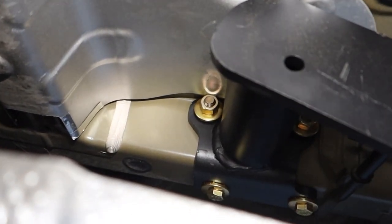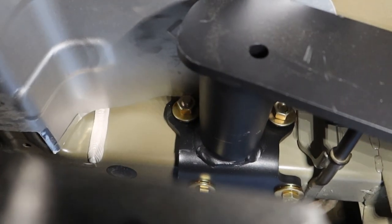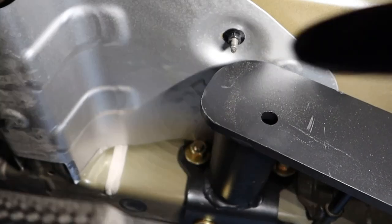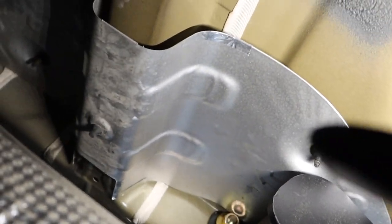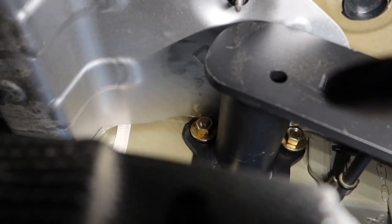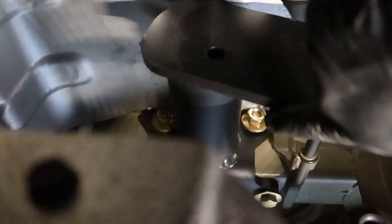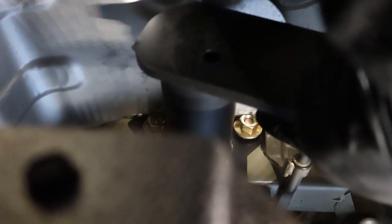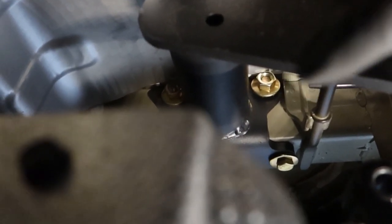For the exhaust side — the side that the exhaust is on — you want to have the nuts facing inwards. Because if you do the head this way, it's going to hit that heat shield. I've seen write-ups saying you have to cut a little bit of the heat shield out of the way so you can get the head in. But if you just install it backwards, it'll work. You just push it through a little bit where you see a little bit of the threads, put the washer on, and tighten the nut. If you push it out any further, that nut actually hits the heat shield, but there's enough space that it'll fit in there. So put a wrench on it and tighten the other side — the threads will come through but it's skinny enough it's not going to hit that shield.